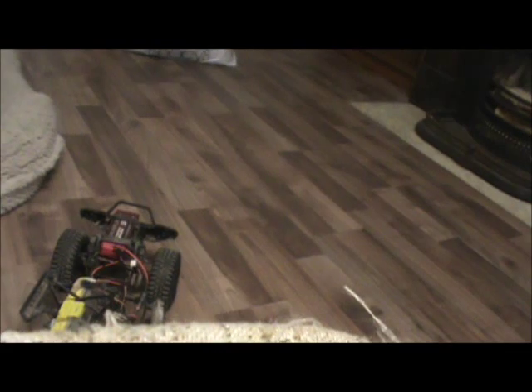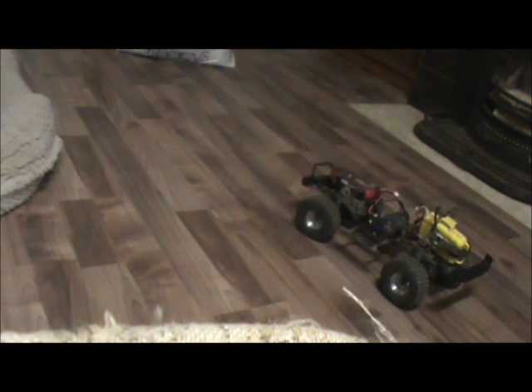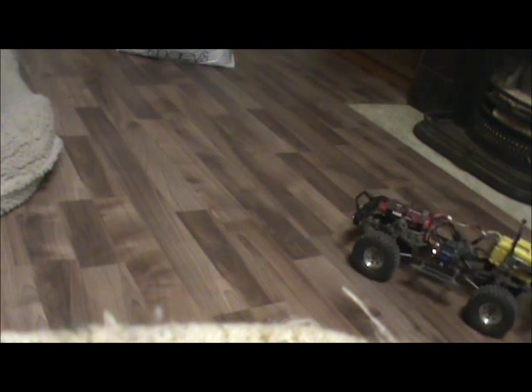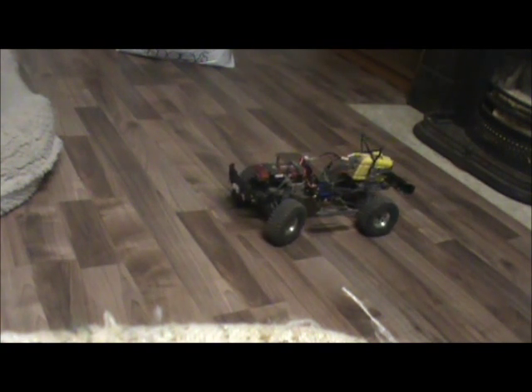I put this together and it's working pretty well — it works good. I like this ESC. It doesn't have that Novak whine — the high-pitched squeal when you went real slow. This has a real nice creep to it; you don't get that irritating ringing sound. Same with reverse — you get a real nice low creep. I like the brake; you can set it to all different kinds of things, but where it's set now it's just a nice smooth brake that doesn't come to a complete stop, so you can creep with it quite a bit. The motor's got some good punch to it. It's working good, and the motor isn't burning up like it was before.